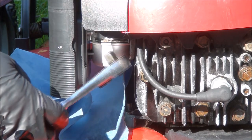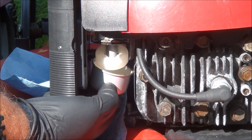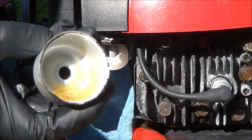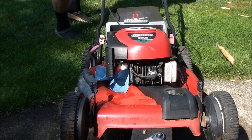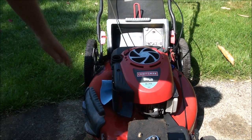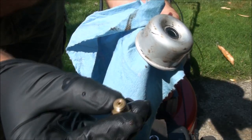To get the float bowl off you usually just give it a little tap and the bowl comes off. You also have an O-ring gasket on the carburetor — looks like it stayed on the carburetor, so that's perfect. Inside the bowl you can see it's definitely contaminated with water and sediment, so we'll want to clean this out thoroughly. I'm going to set this down so any remaining gas inside the gas tank drains out through the carburetor. You can see that's the gasket — don't lose that.